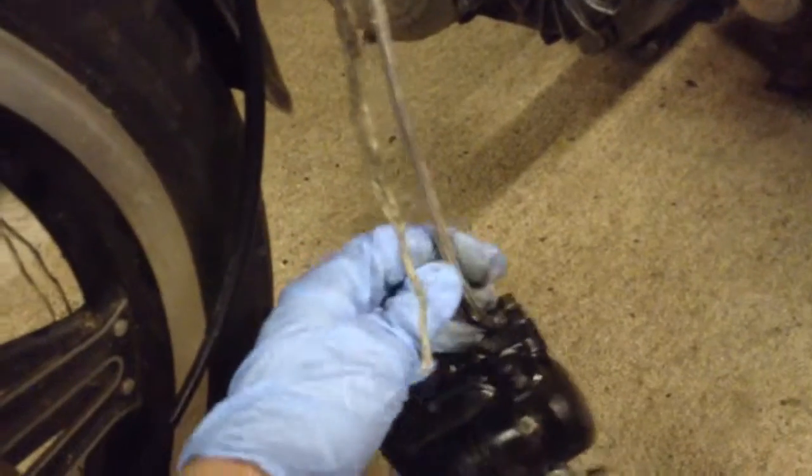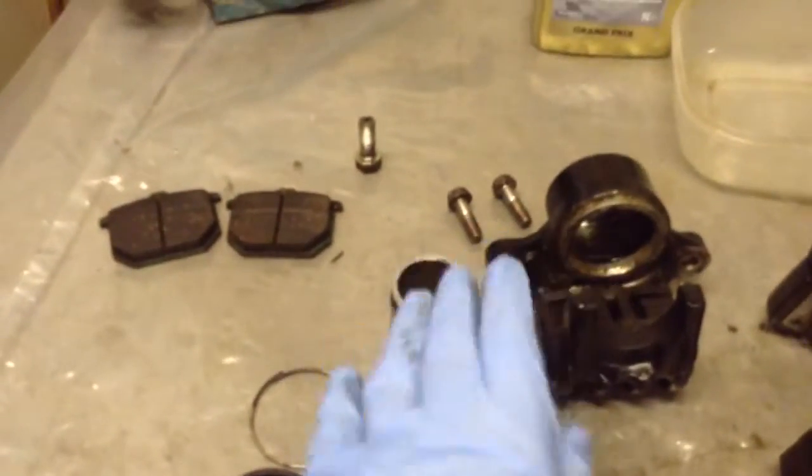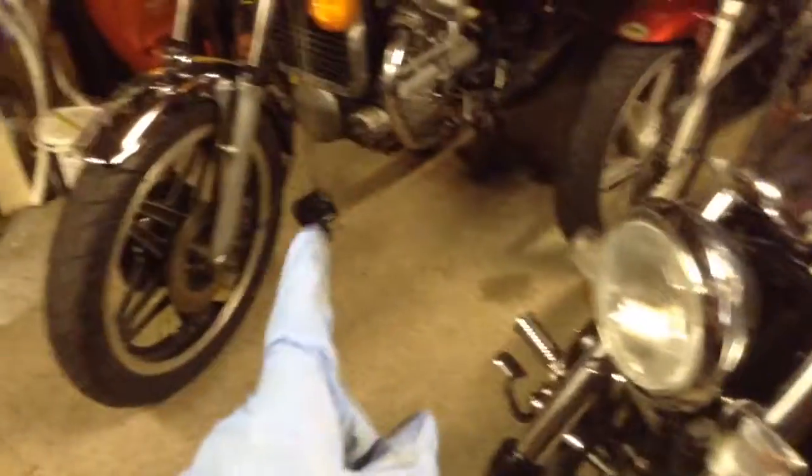Additionally, part of the issue is — this is hanging free now — but you have got a bit of a kink there. The way these operate, of course, is under hydraulic pressure. Putting them on isn't generally a problem. But the fluid returning back up the pipe through the vacuum of the master cylinder can be a problem, if you've got crap and gunk in there stopping them from just sliding back under vacuum, or you've got crap and gunk inside the actual hoses themselves.